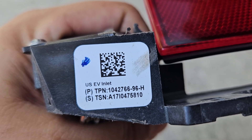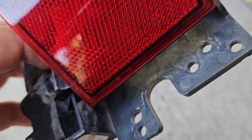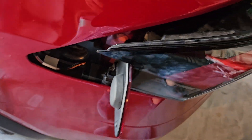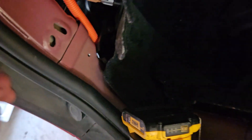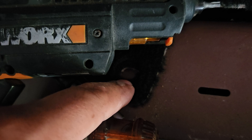This is the inlet — it attaches to the rear left driver's side brake light. Tesla wanted $350 for this repair, but I'll show you how to do it quickly. What you need to do is open the area up, take off the weather stripping, remove the kick plate. There are two Torx screws — one up top and one on the other side — then gently pull it off and remove the plastic snap clips.